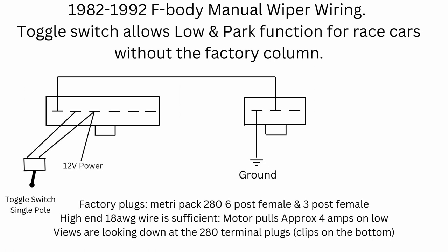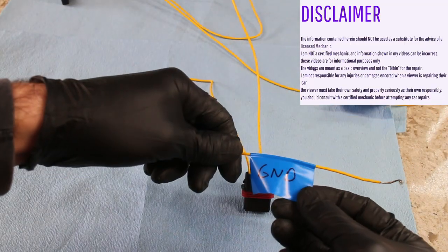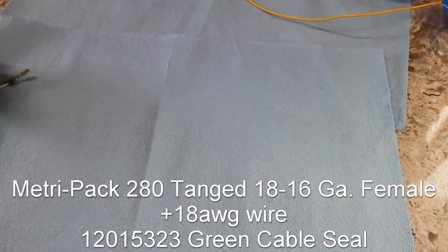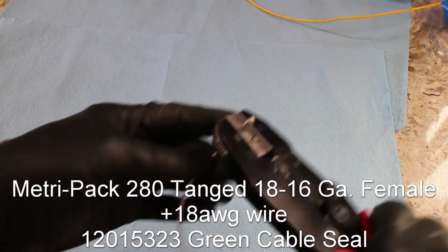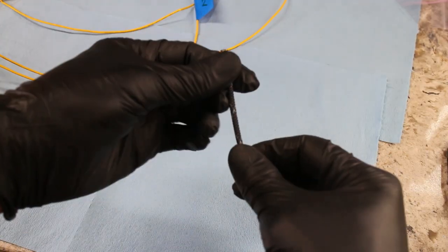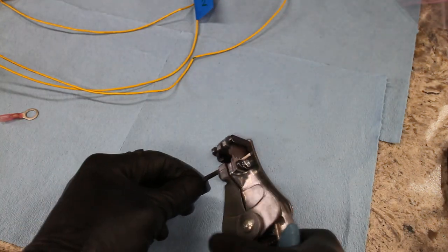My brother tested and made this wiring for me, so now all I have to do is replace these cheap wires with good quality ones. I'll start with the ground wire. It's fairly short and will ground to my driver's side cylinder head. A female terminal is crimped on — this is a MetriPak 280. The wire gets sleeving and then a 3/8 ring terminal to connect to my cylinder head.